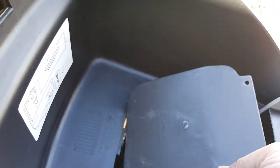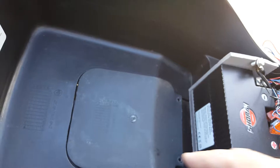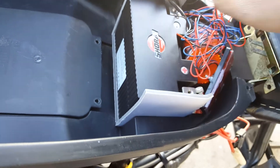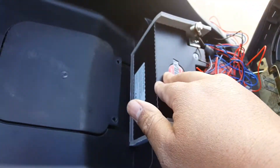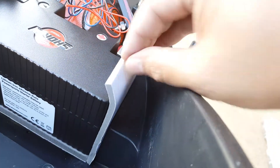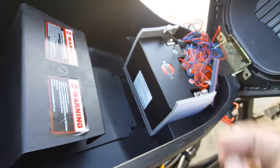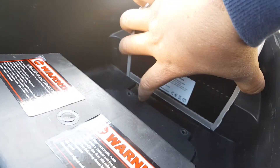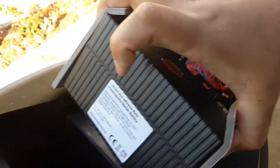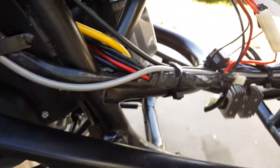Here's the cover that goes on to the back of it — two little Phillips screws, just gotta screw this in there. This has screws underneath, two of them. I forgot to tell you — you can actually cut it to customize it how you want. I think this is perfect because once it's in here it'll kind of close in and collapse on itself. It doesn't get hot so it's okay to put the cushion on here that came with it. You can use this as adhesive backing and have it permanently there, but I'm just going to have it fold in like this because the cover comes on. There's enough height where it can fold inward and also protect the terminal from moisture. I decided to put it in there just to give it a little more space. The screws are already screwed in there — it's mounted securely. Put some washers because these are plastic; you always want to make sure you get washers underneath to help keep the plastic from ripping through when bolting it down.